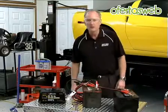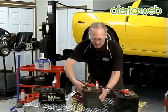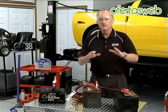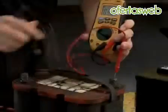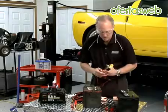We're back — it's been an hour. We want to check the Optima battery and see if it's above 10.5 volts. It's also a good idea at this time to check that the battery is not getting super hot. If it's getting real hot, it probably has a short in it. Warm is okay — touch all the cells on the sides of the case. If it's getting real hot, stop this process and disconnect them; you've got a bad battery most likely. So we're going to disconnect these now and check the voltage — 11.67 volts. That's plenty of voltage to now hook up the battery charger on its own.